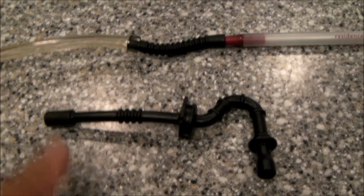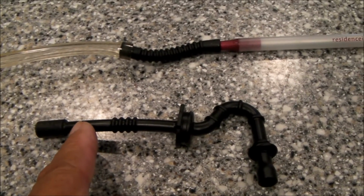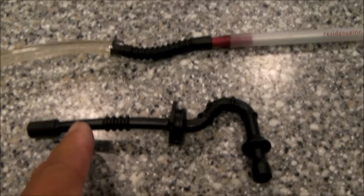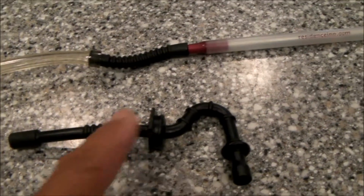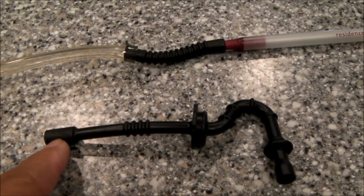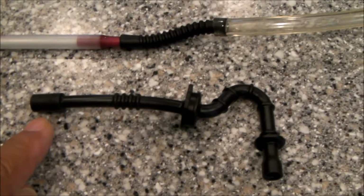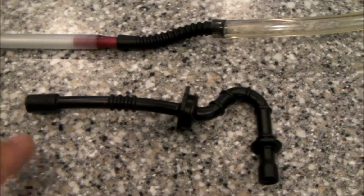I might add that while this method will determine whether you have any small leaks in the hose itself, it will not help you identify leaks that are occurring at the ends. Ends could be at fault due to swelling, age, or deterioration.